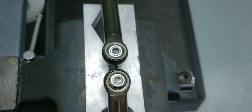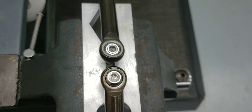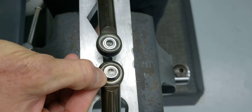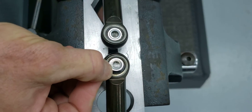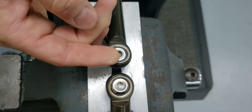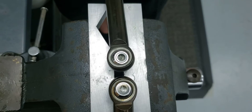If you look with a mirror under your bike and it's very hard to see an edge on the part, then yours is almost certainly nicely staked. If you can clearly see these at this edge, then it's more questionable.